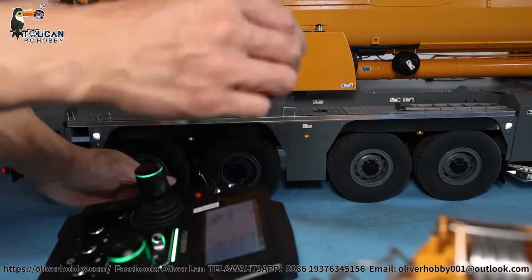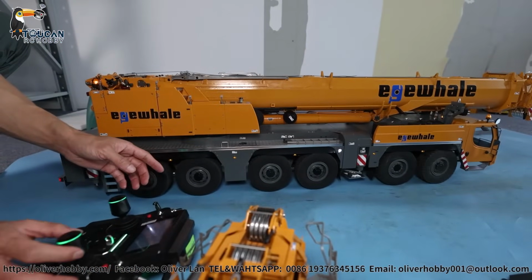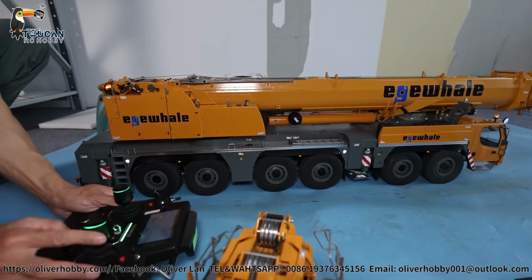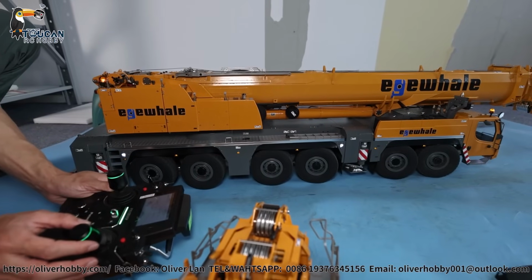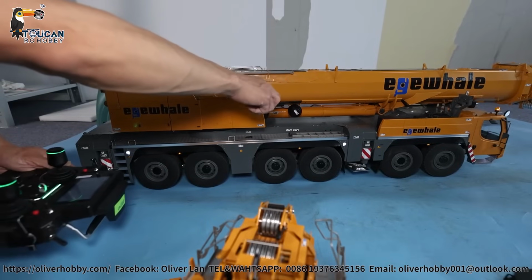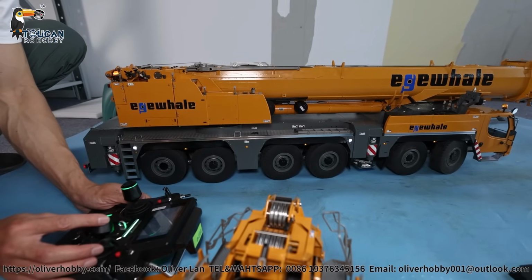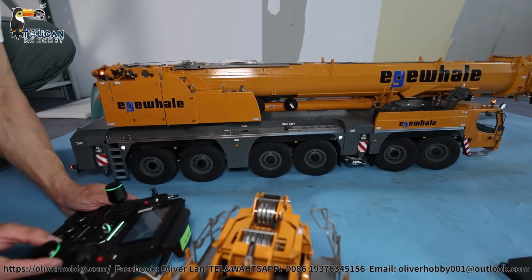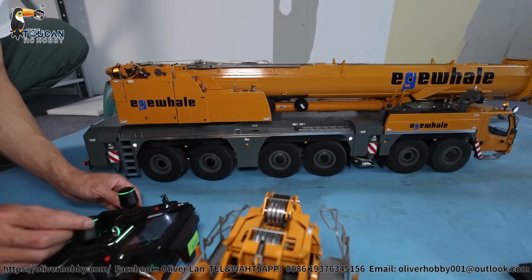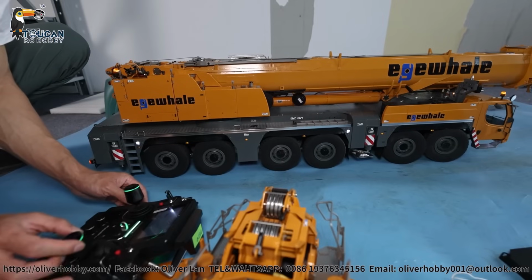And then for the steering, that's mode 1. Mode 1, front steering, rear steering, reverse direction for a small circle. Mode 2, so all steering in the same direction. For all these axles, how much to turn can be controlled from the board. Later, another video will show. That's mode 2. Mode 3, so only front steering, with the rear turning less and less. Mode 4, only rear turning. Again, mode 1, circulating, front and rear turning in different directions.